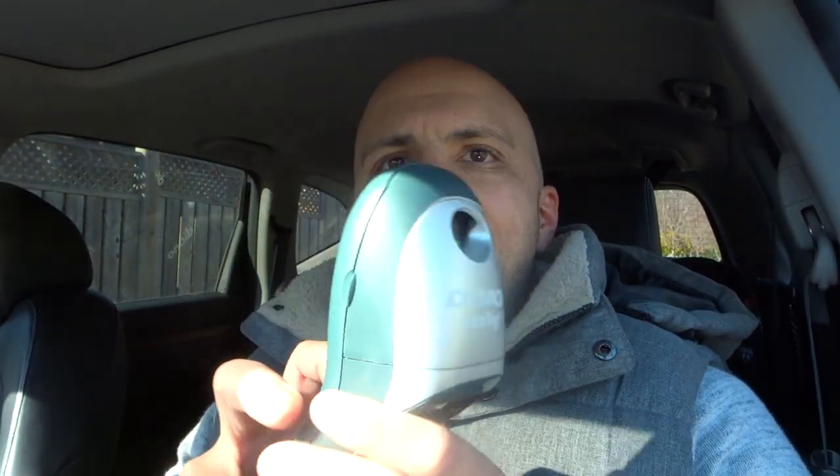The second thing you can try is to remove the batteries. Pop open the battery cover and remove the batteries. Once the batteries are out, hold down the on/off button for about 10 seconds — that will drain the residual power inside the unit. Then replace the batteries back in and try using it to see if that gets rid of the battery low error. It's basically a soft reset, similar to how you unplug a computer and hold the power button for 10 seconds.